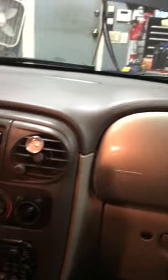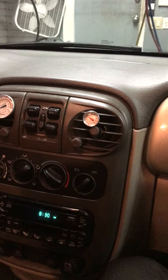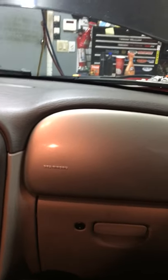Now, if some of you were really smart, you would have caught that high side gauge wasn't moving. And kind of crazy. I don't know if it's a Chrysler thing. I've never, ever seen this before. But there are 3 service fittings on this car. And I mean, I'm a little dumbfounded. But there's the other one right there. So that's how you pick up the high side pressure.